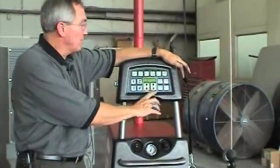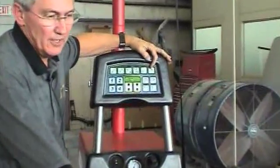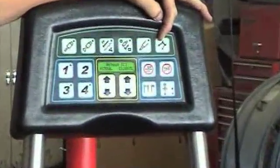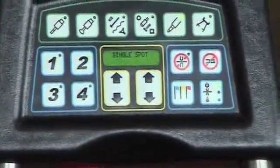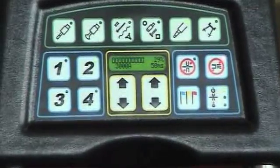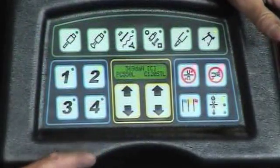The machine comes with 5 different welding modes. The first and the most important, of course, is the two-sided pinch welding liquid-cooled clamp. We also have a single-side welding mode if we're only able to weld from one side and can't reach behind with the electrode tips. When the machine is in the setup mode, we need to tell the machine what arm